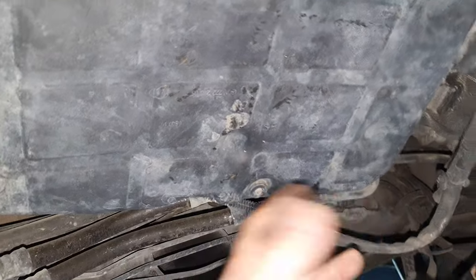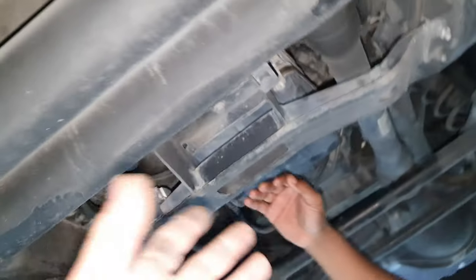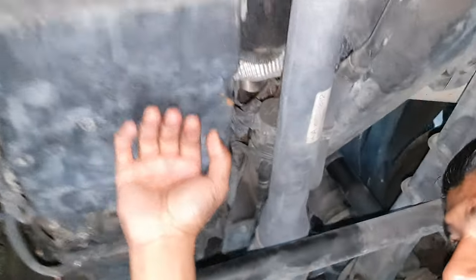All right. Remove the transmission sample. You're gonna take a sample from the transmission oil, get a sample from the transfer case oil, from the engine oil. It has a dent, so we need to change this one also, the oil pan. Yeah, right on the job card.